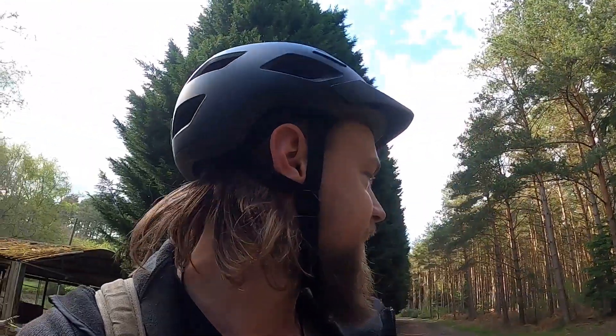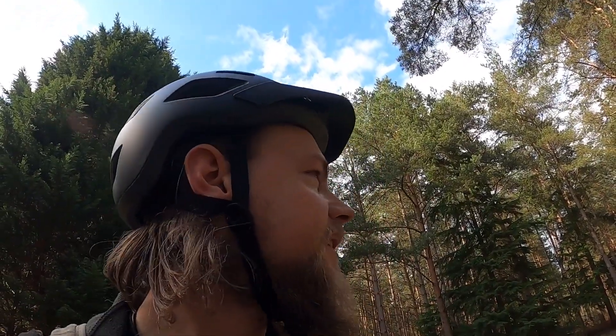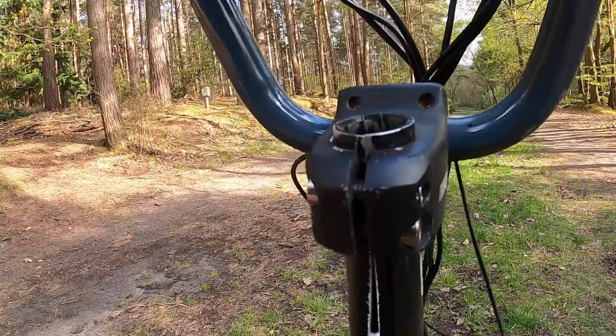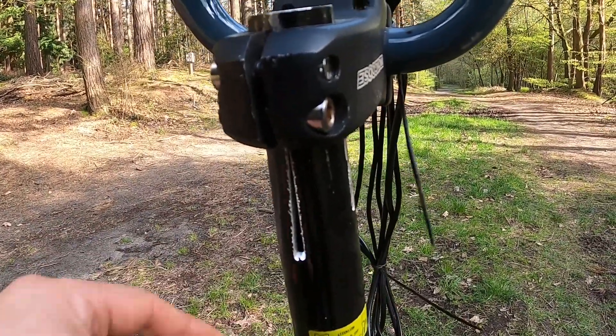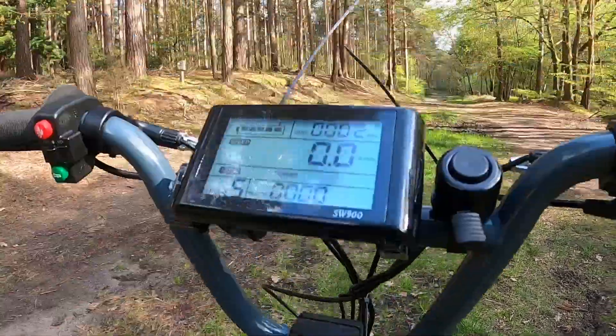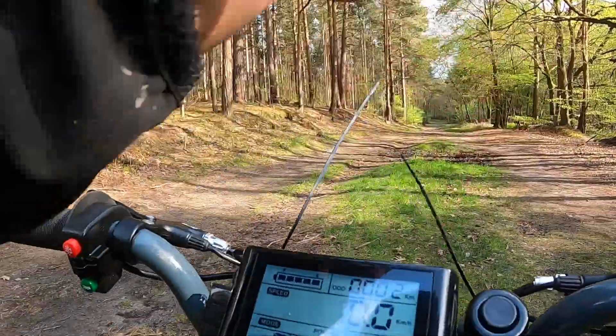So we've established that it's pretty fast. The knobbly tires seem to be doing pretty well — I think they just need a little bit more air in them, I should have done that before I left. Kind of got excited. This isn't the final bike. There are certain things like this stem — I need to adapt it. I'm basically going to cut it off, get a new pole to put in there, and weld it all around, and then the bars will be slightly lower, which will be nice. Obviously cables are still everywhere — I kind of threw it together today and this is sort of a first test run.